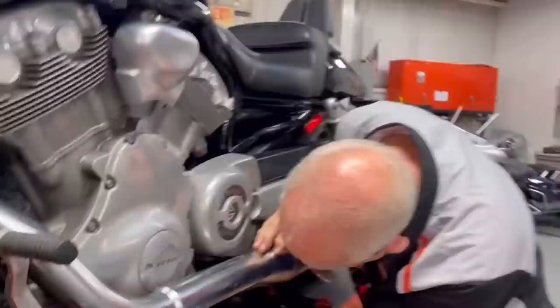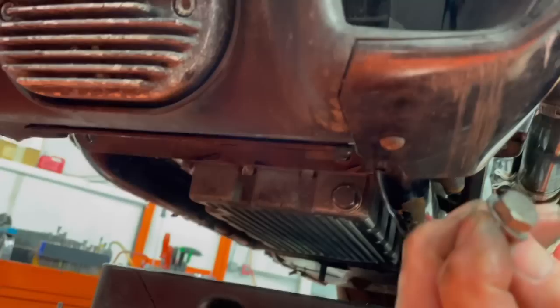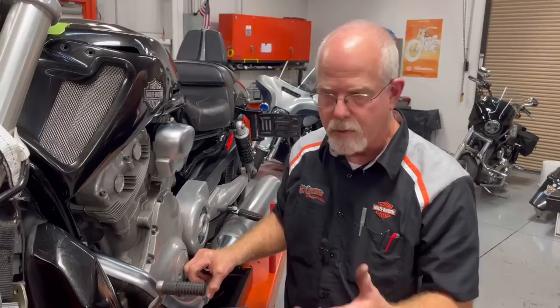You want to help your friend change the oil. You're looking for the drain plug underneath, just like your touring machine or Dyna, and you go, I don't see it. There it is — it's up front. There's an oil filter up in there too. You take two bolts out with a 13 millimeter, take this plate off — it's indexed with two rubber grommets — and now you can get straight to the drain and the oil filter. The oil filter does take a special oil filter wrench; your touring machine filter wrench won't work.